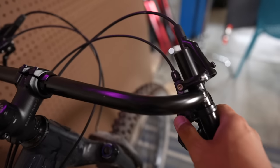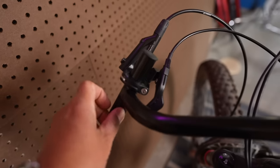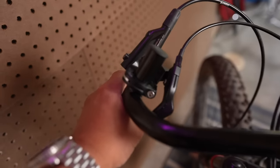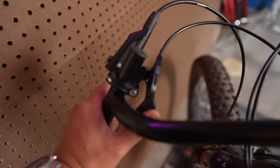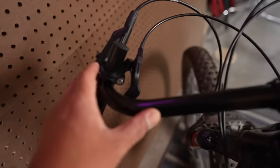What this allows me to do is activate the shifters and the brakes from the hooks. On the other side it's a little different story — the dropper lever and the shifter are one piece, so you can actuate the brake pretty well, but it's a little bit of a tight squeeze to get to the dropper lever. Probably wouldn't be a problem if you have a non-integrated dropper lever, which I do not, but this is what I've landed on.